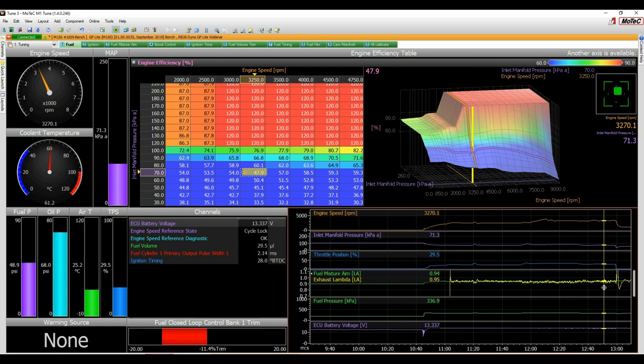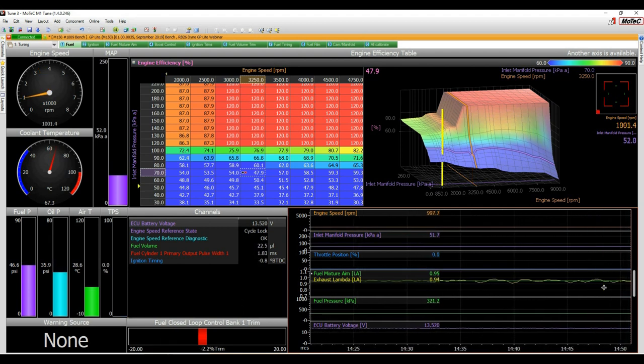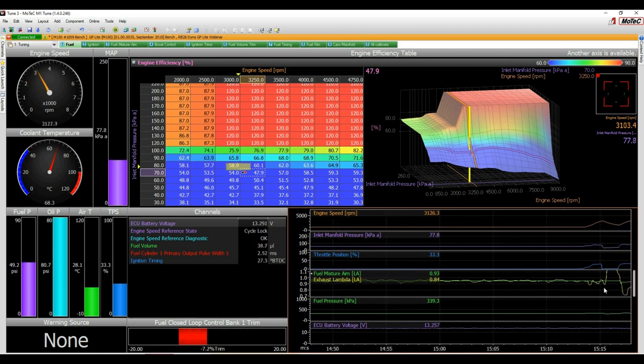just while we're in this part of the map. All right, so I'm pressing T again. Everything looks okay. I'm going to set the dyno up to ramp here. And if you want to study boost control, we have a boost control webinar. So we're just assuming that I've got that done and the boost under control, which I've already checked. Again, just wanting to show you another method of tuning the efficiency map. So we're just going to do a quick ramp. I'm going to turn the pump on.